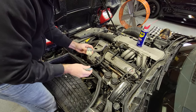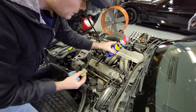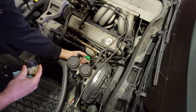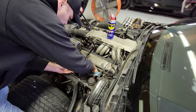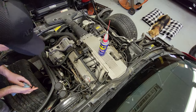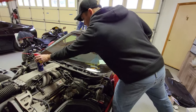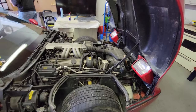Moving on to plan B. This is the good relay that we know is good, and we cleaned it up a bit. I always use WD-40 when I clean electronics — it's a water displacement so you can get all the grease and water out, loves them up real good. Also cleaned this port and plug here, so it looks quite a bit better, not as burnt up. We'll plug in the known-good relay and then operate the vehicle, get it to temperature, and see if the fans kick on like they're supposed to.